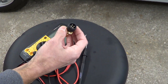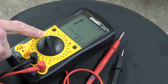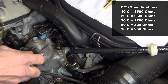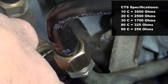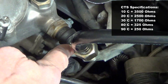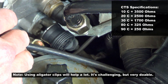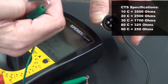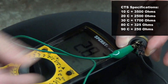It's very easy to test this part with a multimeter. Set the multimeter to ohms, up to 20K. While the sensor is on the car, wiggle out the connector and measure across the four pins diagonally. One signal goes to the EZL ignition module, one signal goes to the car's computer. You should be reading roughly the same on both pairs. At about 11 degrees Celsius, the reading is around 3,100 ohms. You want to measure at least two temperatures — one cooler temperature and one when the car is at operating temperature around 80 to 85 degrees Celsius — and compare to the expected values.